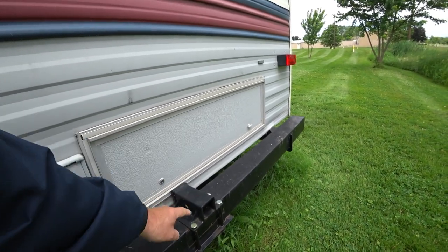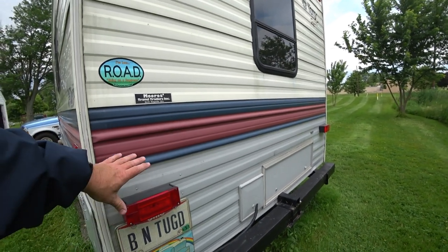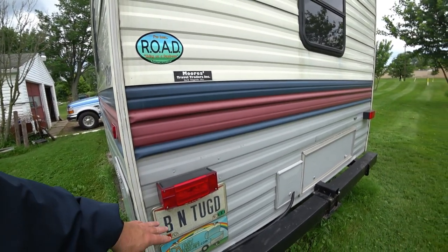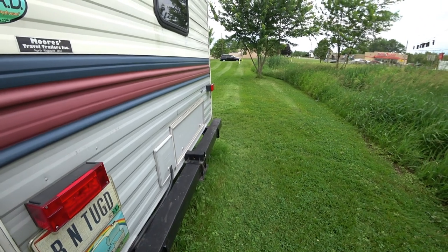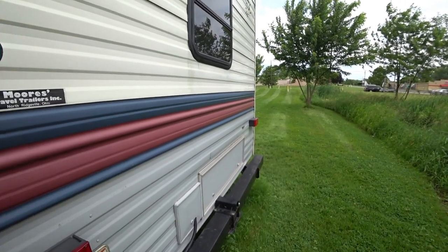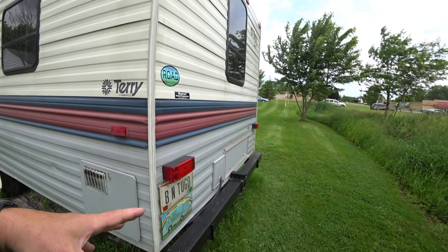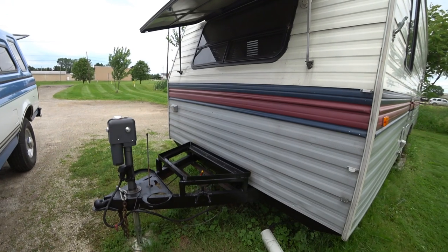If I had a really good brand new bumper I could put a hitch mount and carry the generator back there, but I wouldn't feel necessarily safe. The other concern was the generator blocking the tail lights - I'd have to move them up, and I've already moved them once. Coming out with a support, lengthening and reinforcing the bumper, all that would add weight, and then I'd be carrying a 110-pound generator plus a propane tank back there. That's too much weight. Go check my previous video on tongue weight and safety.